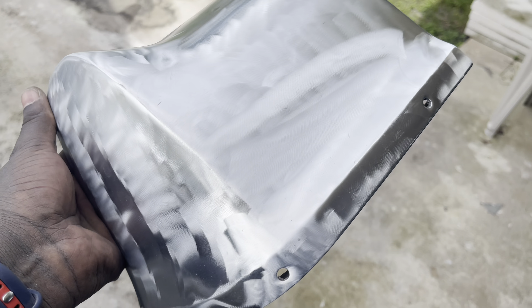Back onto the process — I sanded down with 800 grit to smooth out the surfaces of the metal and to rid the surfaces of deep scratches, because this is a softer metal. You're more prone to scratches if you bump the material, or just little nicks and knacks like that — it affects the metal on a greater level than steel. Then after the 800 grit, when I got it to a smoother surface, I ran it through 1000 grit and gave it a good wipe down.